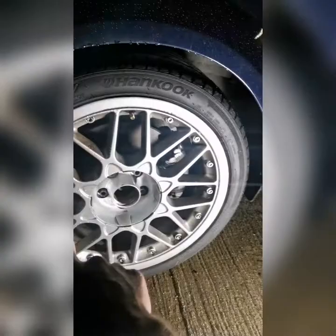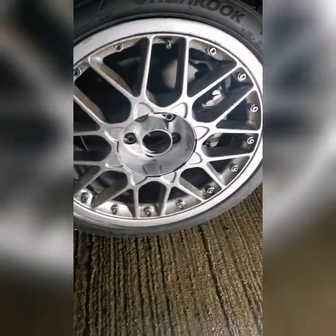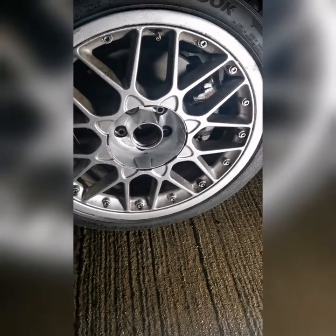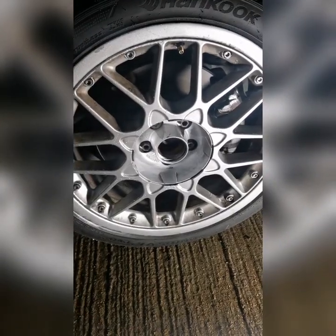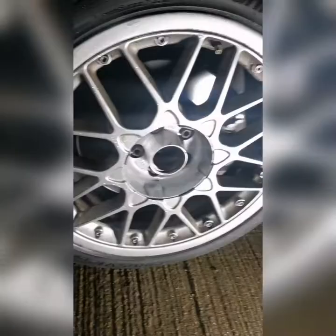What I've done is I've just loosened the bolts for the wheels — they're all 17mm. Just make sure you've got your locking nut so that you can undo that properly, then jack it up a little bit once they're all loose and then take the wheel off. I've just put the wheel over there for the time being.